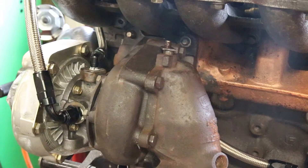The hardest part is getting to the oil feed line if you want to undo it while it's in the car — it can still be done, but you have to remove the wastegate. I generally put the line on the backside of the turbo going off the block on afterward, and the one on the backside going to the head and the oil feed line I usually leave on the turbo when I install it. That just makes everything simpler. AN lines on a turbo — this thing's going in the car next.